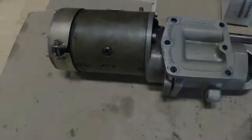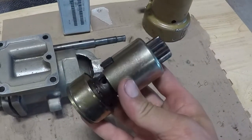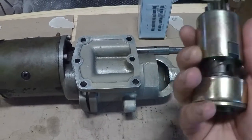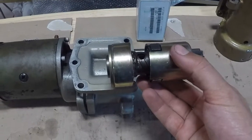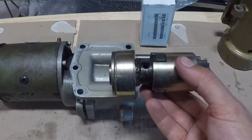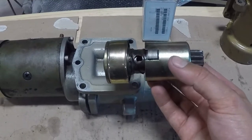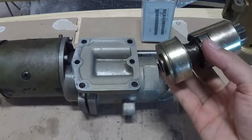Let's have a look at the tool bench in front of me. We've got a starter motor here — this is the unit we're talking about. This is the Bendix at the front, and it would live inside this housing. These are what quite often will fail. You'll be in the airplane, you'll go to start, turn the key, and you'll hear a whizzing sound from the starter and no engagement. That's this failing. And this can be removed and replaced.